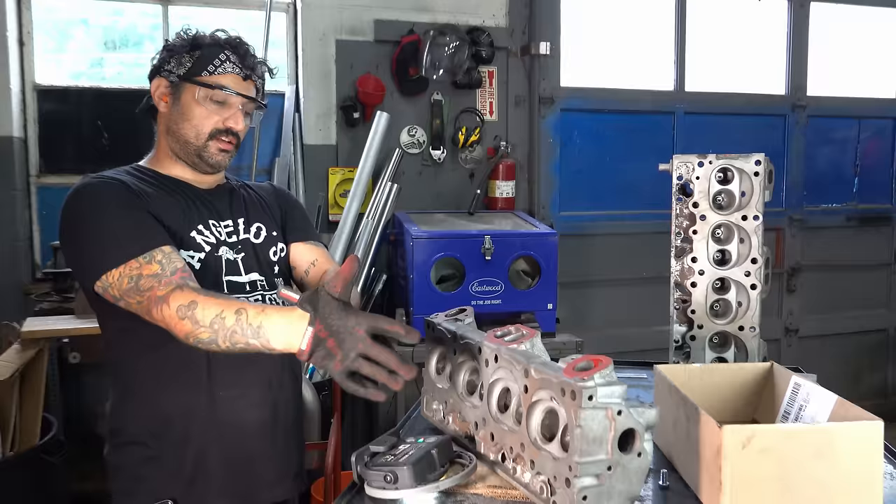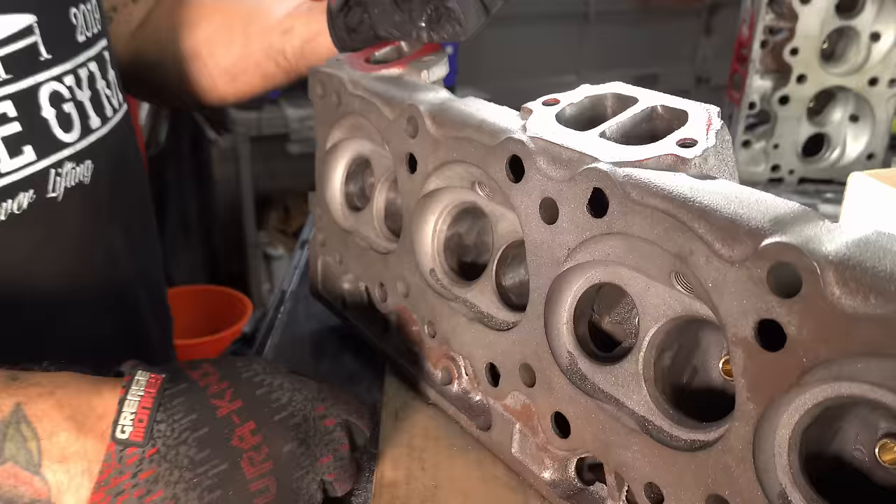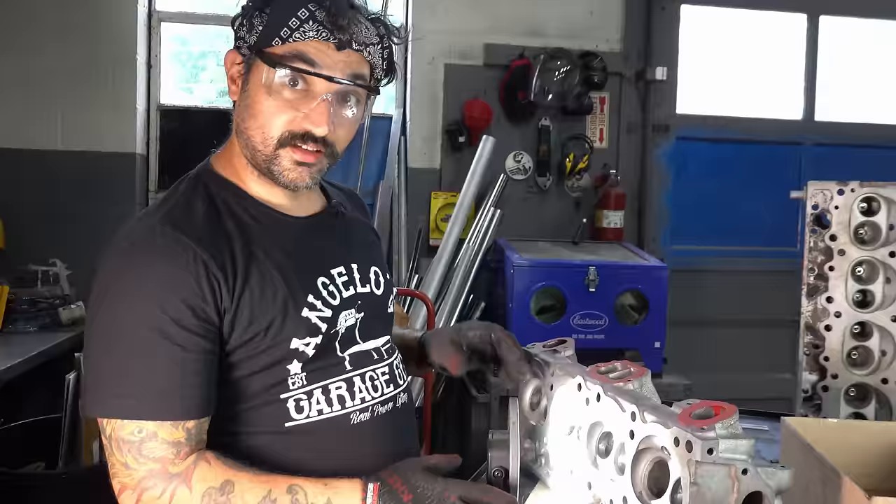I have just about cut what we need in the bowl for the exhaust. You can see the basic shape — I'll take a little bit more out but we're pretty much rocking and rolling there. My arm feels like I've been riding a chopper down the coast for two days — feels like it's going to fall off. But it's free horsepower.